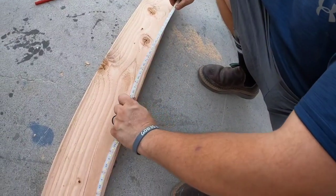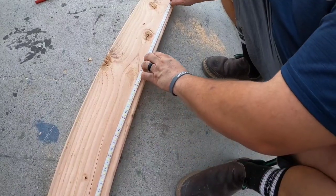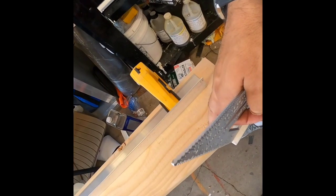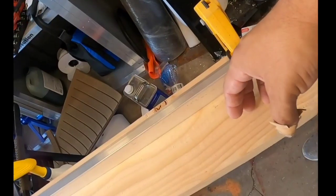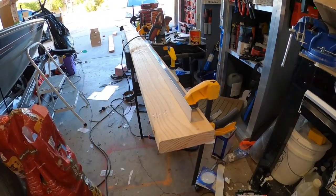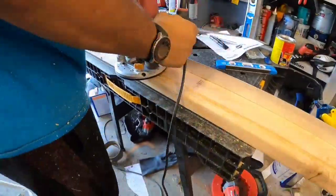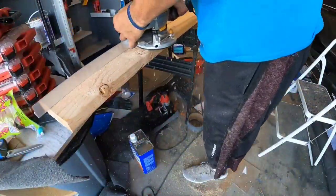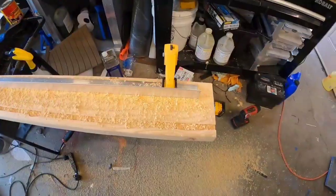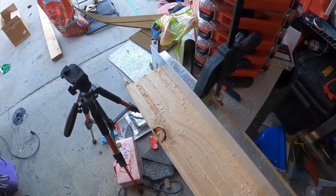The more it's going to shine out from the boat, so we'll route the very edge. We need a router bit that's thick enough to do that. We're going to run it at an inch on the outside — the most outer part of the bunk is where the light should be. That's where we're going to make the route. I have a piece of angle there to act as the jig line for this router. Right there on the very edge, we are using a half-inch router bit, sunk down about a quarter inch.